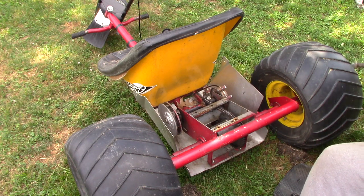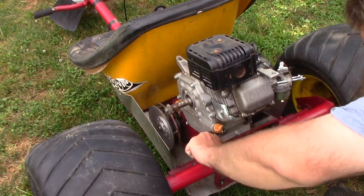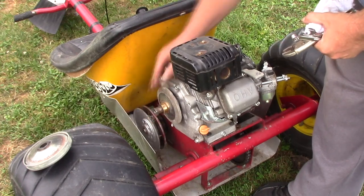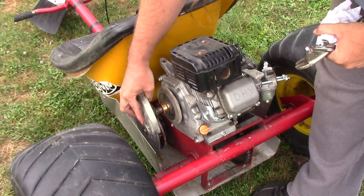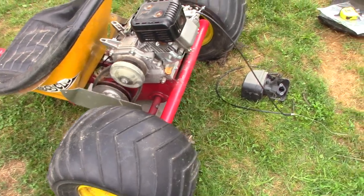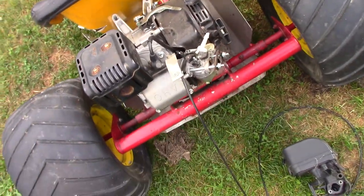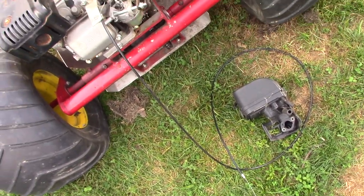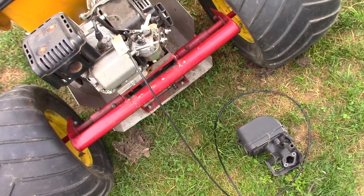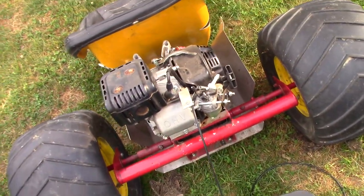Now I'll go ahead and stick the engine back on. We fixed the axle, got the engine mounted on there, got the clutch on there, and the belt on there. The throttle cable I have here isn't long enough — this one's about 81 inches and I need one that's about 96 inches. So I'm going to have to wait on the throttle cable. I ordered one that should be here in a couple days, then we can put the airbox back on, run the throttle cable up, and this will be good to go.